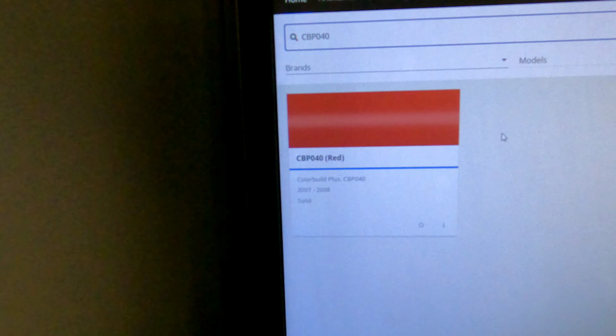So a little while ago, I put up a short with Equinox. I stayed late one night and painted. With that one, I hammered out the bodywork during the day, and then instead of putting on primer and letting it air dry for 8 hours, which is recommended, I sprayed our SIKKENS sandable sealer. So this is kind of what I'm talking about here.